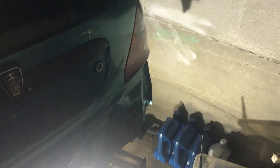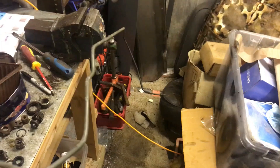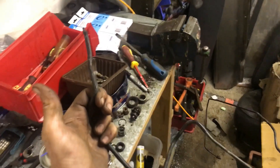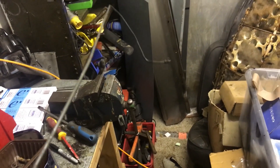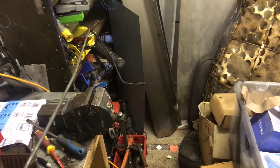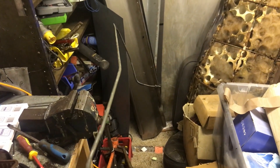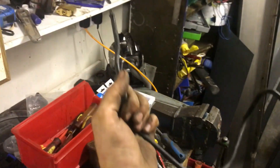Back to the car, got it really high in the air because I want to get the remainder of the brake hoses out from the underside, the other caliper off, and get ready to paint the brake hoses. Then that newly repainted fuel tank can go back in. That is the brake line that goes from the near side rear of the floor pan, just ahead of the rear axle, then up behind the fuel tank, down and out to the offside rear wheel.